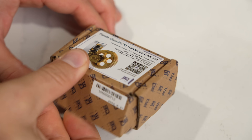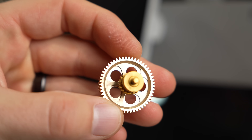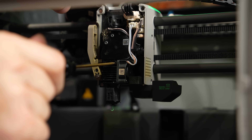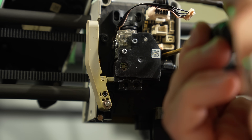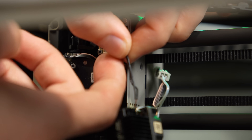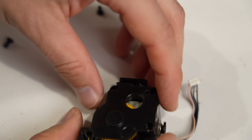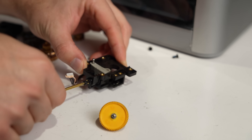While we're taking apart the toolhead, we're also installing the Panda Claw extruder gear. This replaces the stock plastic gear with a nano-coated hardened steel gear and CNC tension arm. For anyone that hasn't taken apart the toolhead or swapped out the hotend, it's a fairly simple process. Two screws hold the hotend in place, and three hold the extruder in place. You need to loosen the screw holding the blade into the extruder and swing it out of the way. The cables are fairly small, but disconnecting them from the toolhead is straightforward — they're all different sizes, which prevents you from accidentally reinstalling them incorrectly. Once you have the extruder out, there are four screws to remove that hold the two housing halves together, and one screw to remove for the tension.